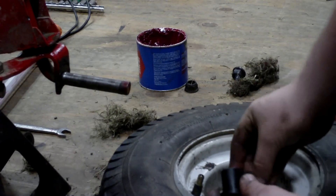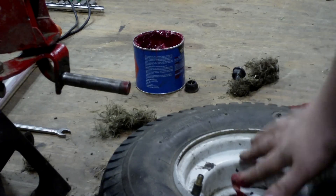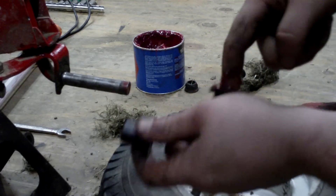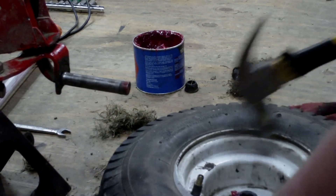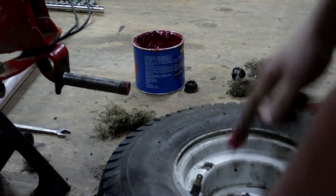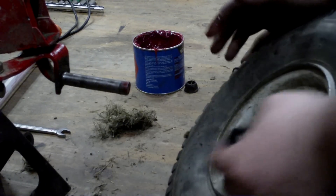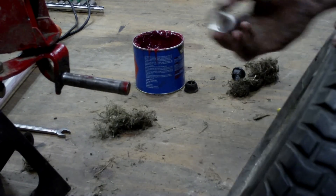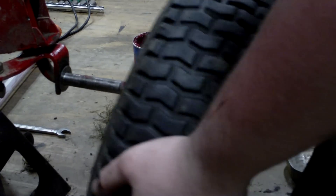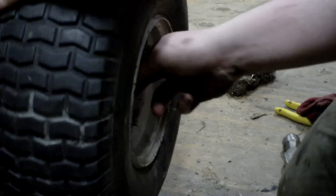Now you want to take the new ones. I'm going to put a little bit of grease in there first — I say a little bit, but that's a whole lot. Put that in there like that. I'm using way too much grease. My theory is it's always good to have more than enough. Also a note: after I put the bushings in, it's real solid now. And you've got to put a washer on here — it's real easy to forget. Just going to slide it on there just like that. And if you got too much grease in there like me, you're going to have all kinds of it coming off.